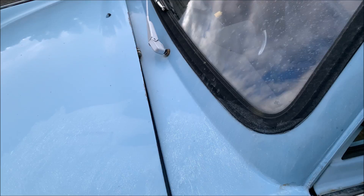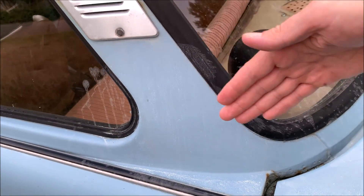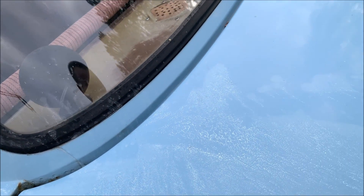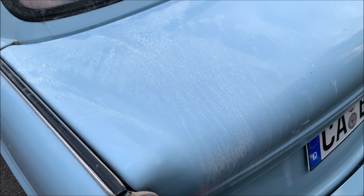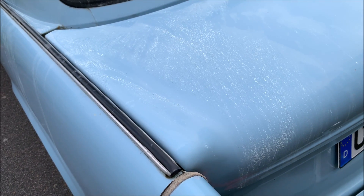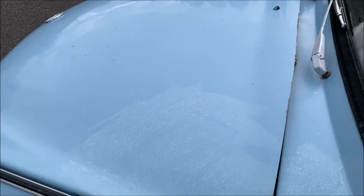At the back we can see some flow along the C-pillar and on the tailgate, going a little bit towards the center — something visible here. But the rest is again dripping, because it wasn't dry while driving. It's not really a separation line we can see here; this is just the fluid dripping down. So flovis is definitely not the right method to analyze aerodynamics under these conditions.